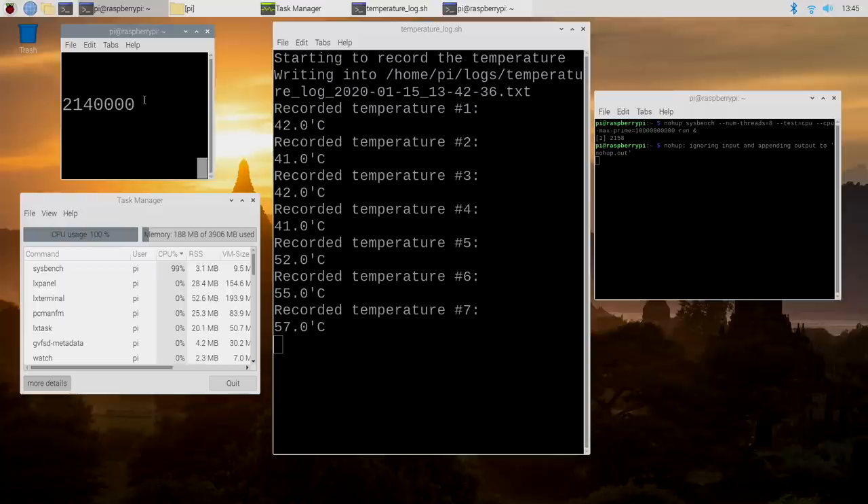I've also set a temperature limit on the CPU — instead of throttling at 60 or 65 degrees Celsius, I've set it to 80 degrees Celsius. If it ever goes that high, we'll see it in the recorded temperature and the CPU will drop back down to 600 MHz. With the included script, at 55 degrees Celsius the fan turns on at 10%, at 60 degrees Celsius it goes to 55%, and at 65 degrees Celsius that fan hits 100% — so it should be pretty loud, but at 10% it's not that bad.